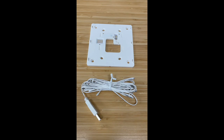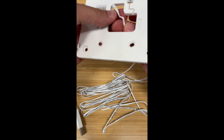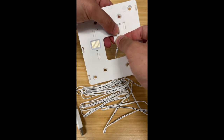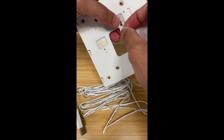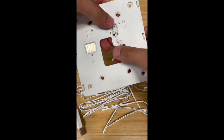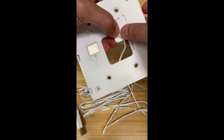Now with the back plate and the power cord, undo the power cord and thread it through the back of the back plate. Connect the power cord to the back plate with that two-prong connector. You'll feel it click or snap into place once you've made the proper connection, then thread the power cord through the indentation in the back plate. This makes sure that the back plate can be flush.